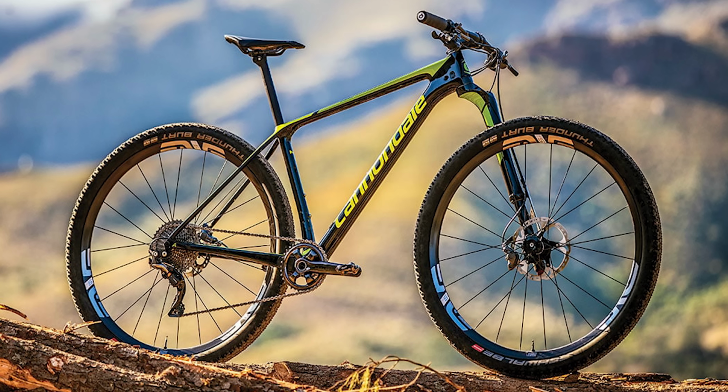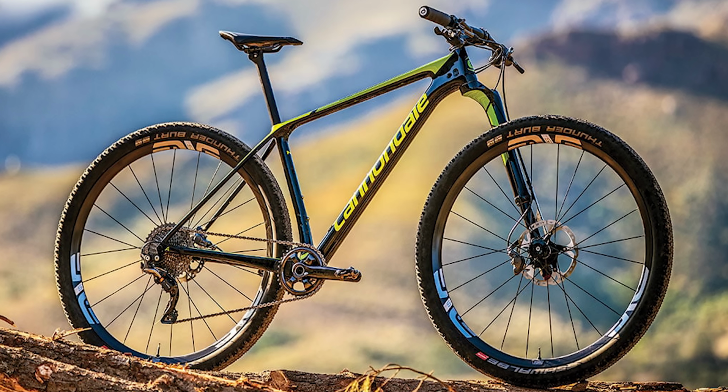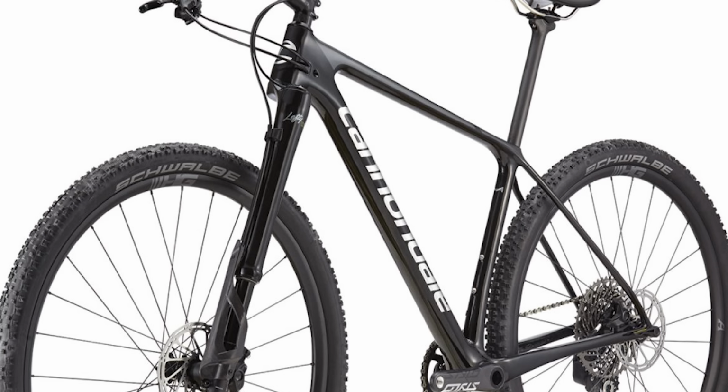A Lefty fork. You get a puncture on the road, or you want to take your wheel off for some reason, you can't, because you have to take the brake caliper off. Just an absolute nightmare to work on. It's just not needed. Everything else works. Alternatives would be any of the other big manufacturers if you wanted that, a Specialized, a Scott, a Trek, but not the rim brake Madone because it's got awkward brakes on it and you just don't want to get in that kind of mess either.